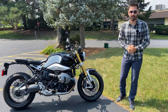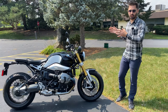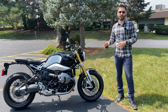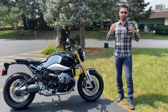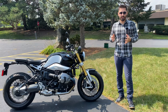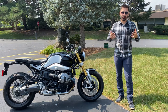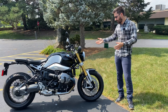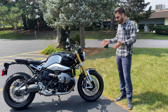The next item is the TPMS — or rather the lack of TPMS sensors on this bike. It's expected on an old-school styled bike. Make sure you check your tire pressure. When I picked up this bike and rode it home for the first time, I was wondering where all the great handling everyone talked about was. The bike kept trying to stand up and was slow through turns — it just didn't feel right. The 15 pounds of pressure it was missing from its tires made a huge difference. Now the bike is very confident on the road. I was expecting at least a warning light, which is what I'm used to with cars and most modern bikes.